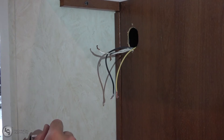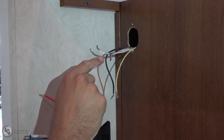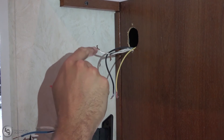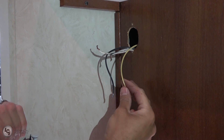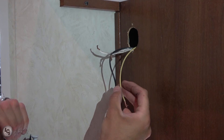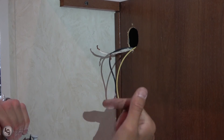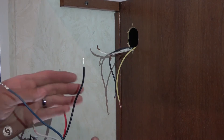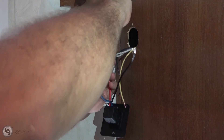Let's go ahead and wire up our switch. We've got main power and ground hooked up to our ground inside the coach, and then power going to our battery. On that power wire we have that 15-amp fuse. Down here we have a solid yellow wire and a solid black wire. The solid yellow wire is going to send 12-volt signal out to our awning, and the black wire is ground. When operating the awning, that will get switched inside of our switch. First, let's get the power hooked up from the coach to our switch.